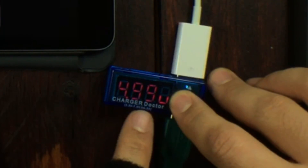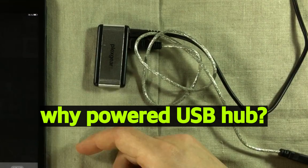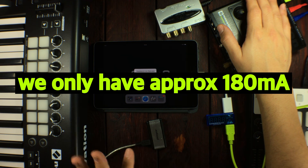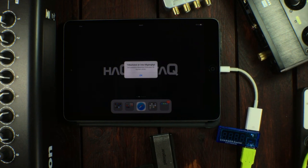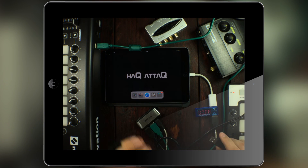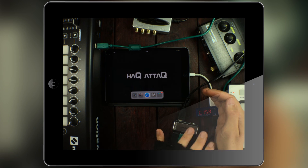I've made videos about connection errors and multiple USB devices with iOS before, and one question I get asked a lot is: why do I need a powered hub? Well, simply because the iDevices are limited to give out about 180 milliamps before everything starts shutting down. When you reach a certain amount of milliamps of current being drawn from your system, stuff will just shut down. So how do I know it's 180 milliamps? I'm going to show you a clip from testing I did where I connected multiple USB devices through an unpowered USB hub connected to the CCK connected to the iDevice.